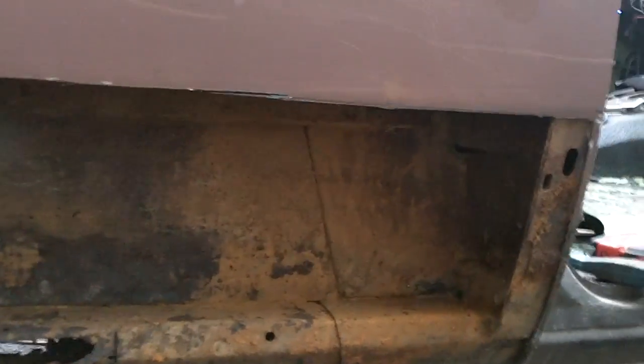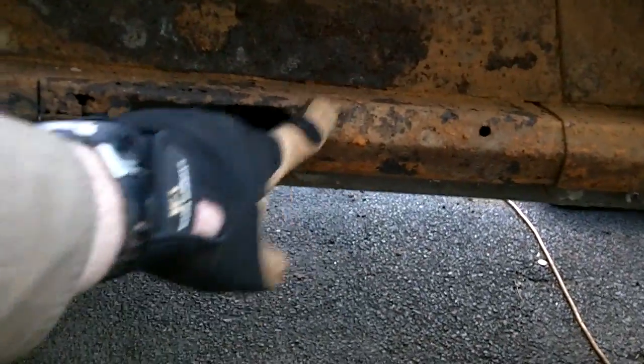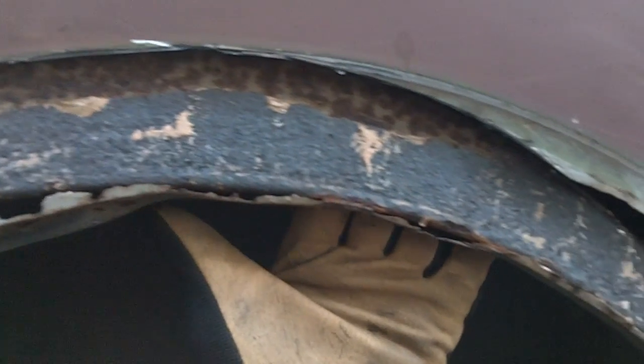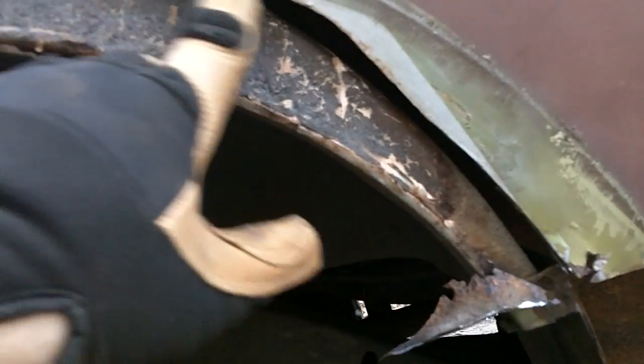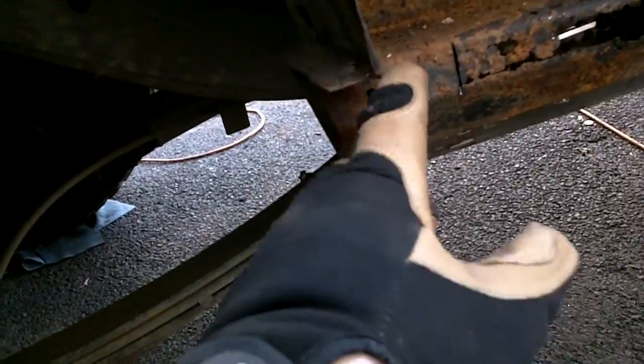I know she kind of looks like a disaster now, but we'll see if we can put her back together. I got this open, got it cleaned up, got an inner piece coming through, so I'm just going to cut that out — probably put angle iron across there. I'm going to open up these wheel wells. The actual inner wheel well is up there, so I'm going to trim the outside to match, cut this piece off, and re-attach them right at the top where they meet. There was bondo over a piece there, so I'll have a couple filler pieces to line that up. We're going to knock this inch off the inside wheel well — that'll give better room for the 35s to come all the way over without interfering with the fender.